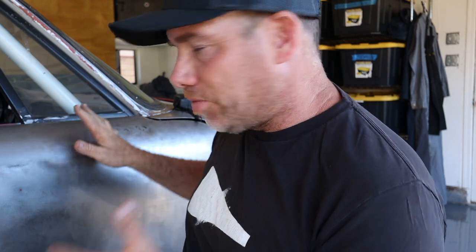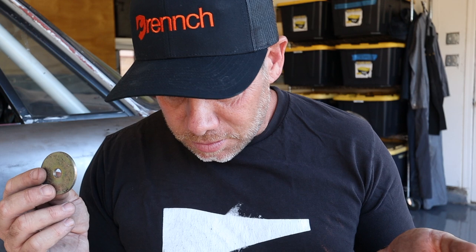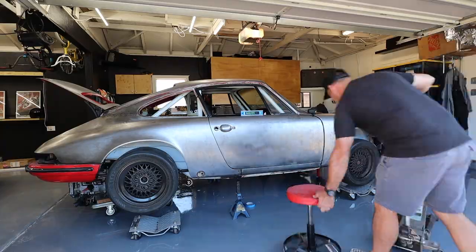A bunch of washers here, and what I'm going to do is go around and try to level the car out, and once I have it relatively leveled, it has to be level, then I'm going to get in underneath, pull the wheels off, and size up what the transmission looks like fore and aft. I'm going to line the axles up and then see what my forward mounting looks like. If I can use some of the existing fabrication, I will, but I have no idea until I actually get under there. For now, I'm gonna mess around with the jack a little bit, mess around with these washers, except that one, which is now in another continent, it's still going. Make sure I have this thing fully level this way, and moving on.